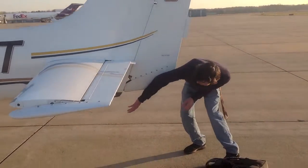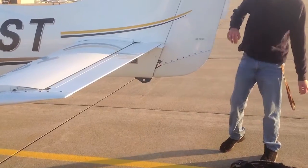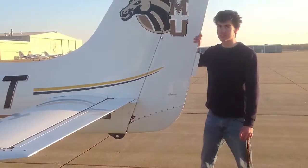Come back to the bottom side. Make sure there's no evidence of a tail strike. Make sure the tie-down is removed. Then check the rudder for full and free, correct movement.